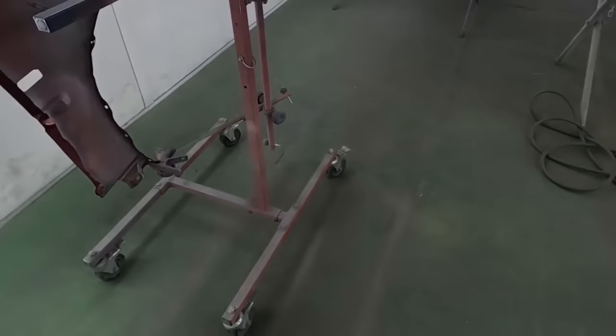We'll run one piece of paper on this whole complete side and then the other side as well. Now here we're using 18 inch paper. You're going to find that we're using paper rather than plastic because this is a full paint job. And it's going to help you out also if you get a masking tree. This masking tree stand is really going to help with the paper to get a piece of tape on it and just help things move a lot quicker.